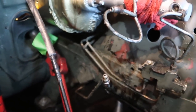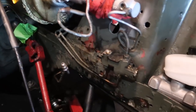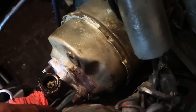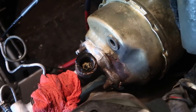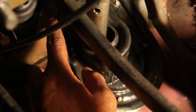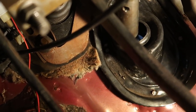There's the aftermath of the brake fluid — it completely strips the paint off, down to bare metal. To get to that stubborn bolt, there's no way to get a wrench down on it, so I'm going to have to take off the brake booster. To do that, you come underneath your footwell and follow the brake pedal up. You'll see a U-shaped bracket — there's one bolt, another bolt, and two above that. Once those are loose, the brake booster should come out.